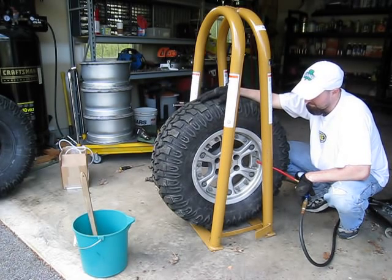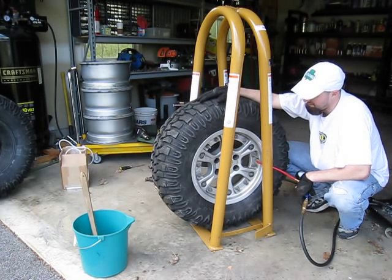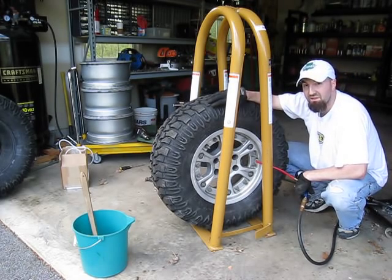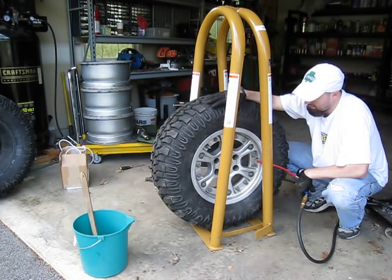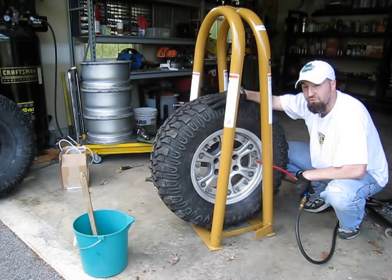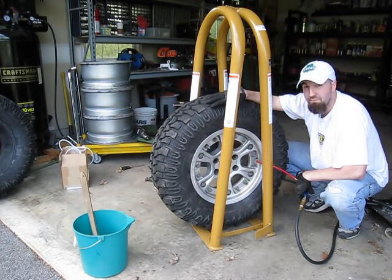That's pretty much the assembly in its completion. It's not too bad. Like I said, the worst parts are probably getting that internal beadlock in place and ensuring that your internal O-ring between the two rims stays in place while you're trying to assemble, to make sure you don't get that pinched in between. Normally I go ahead and air up and let these sit for a day or so and just monitor them and see what my air pressure looks like. Normally within 24 hours if you do have a leak because of a pinched O-ring or other issue, you're going to know it because you're going to lose air. If they're holding air after a day or two, you're more than likely good to go. That's all there is to it. Thank you for watching.